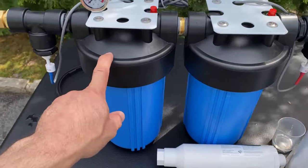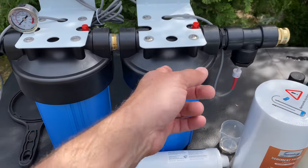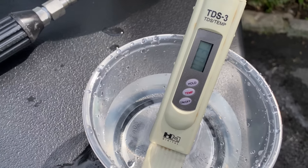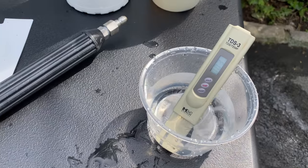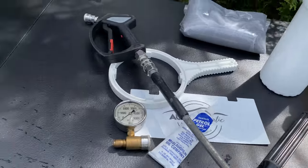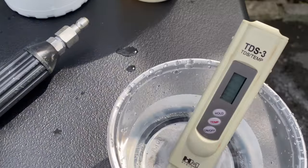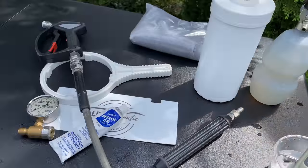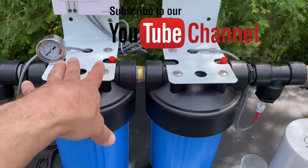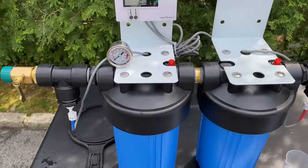The wash is done on the M3. The rotors are not rusted with flash rust, the car was easier to dry, and the water beading behavior is significantly better with deionized water. All product links are posted in the description — you can pick one canister or two. Having two gives more dwell time for purification. Throughout the entire wash we ended up at 3 parts per million TDS — actually lower than when we started. Thanks for watching.